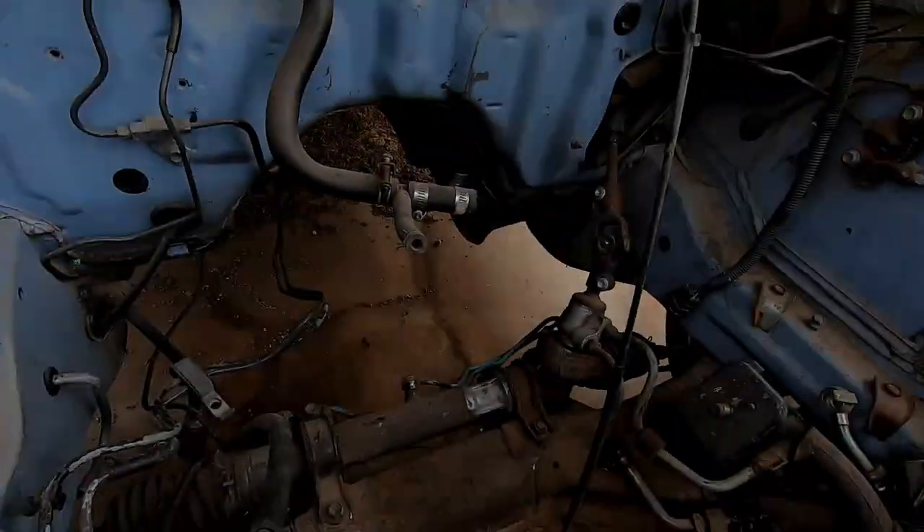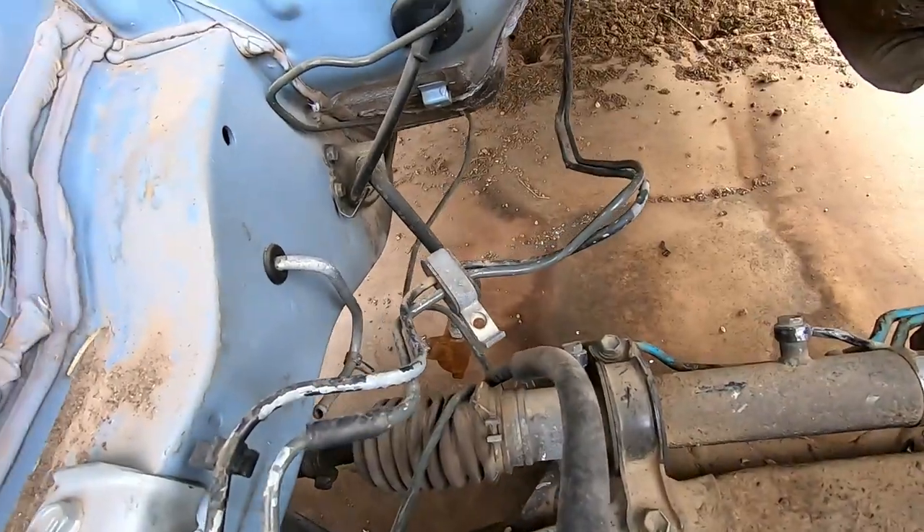It's kind of good that I have a bunch of 86s just hanging around here. I'm gonna try to pull off the slave cylinder from one of them. It's pretty old, I don't know the condition, but it might still be working. I'm gonna pull it off, put it onto Jeffrey's 86, and see if that fixes the issue. This one's a little rusty but we're just gonna send it.